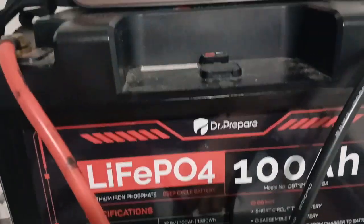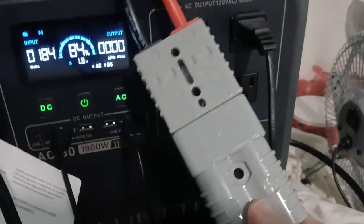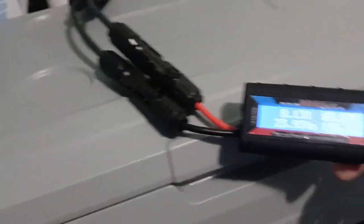So that will charge as long as it needs to. I have it going up to the main battery cables, which will only allow 10 amps max. It goes up to an Anderson 175 to an Anderson 50-amp converter, and then I've got solar MC4 connectors going down from there.